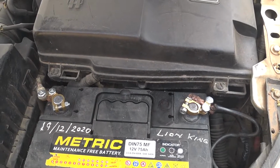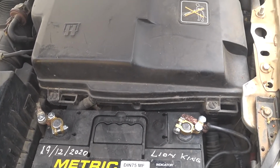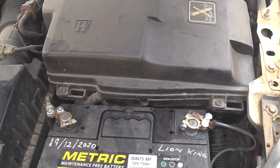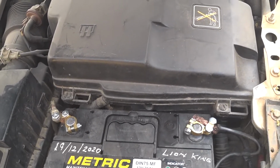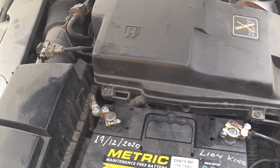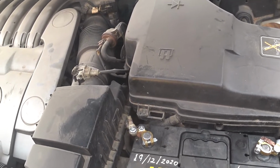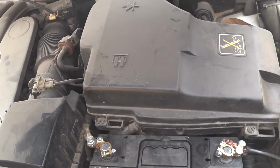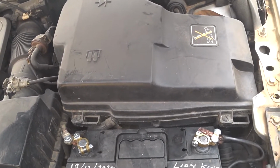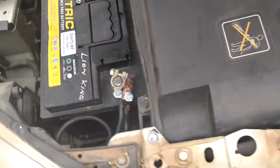While you are connecting back the battery terminal, just gradually touch it. Don't push it in fully, so that if there is a breach somewhere, it will produce a very huge spark. So you can disconnect and then trace back through all the wiring connections, all the places that you touched, to see if there's something touching something that shouldn't be. Okay, so let's start the car and see.